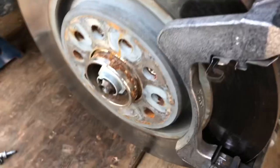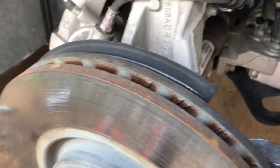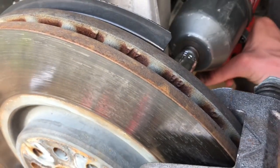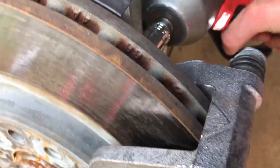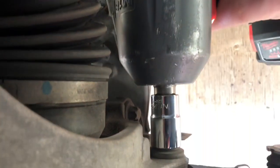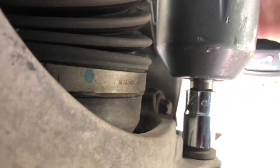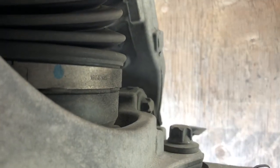For this one you're going to need the E20. There's one up on the top of your knuckle and then another one down right there. Give these E20 inverted Torx head bolts a shot, see if I can get them off here. There's a little tight clearance in here with this big gun. Alright, I'm just going to do the rest of this by hand. The bracket is off.